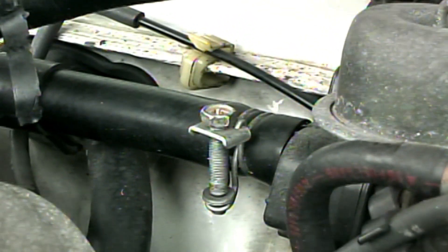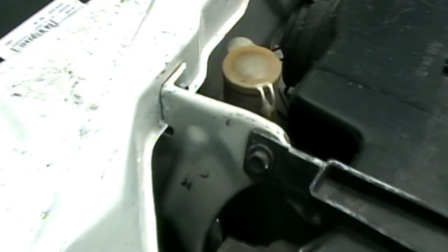So instead of that, we'll go to the back of the engine here straight to the heater hoses and fill it up through one of those, presumably this long hose going to the firewall. Down here we have the reservoir bottle, and I just plan on removing the hose where it connects to the bottle rather than onto the radiator cap itself.